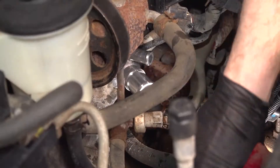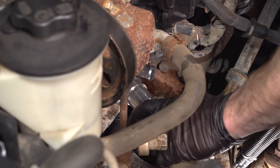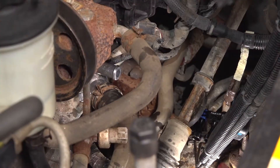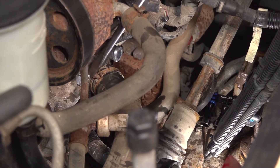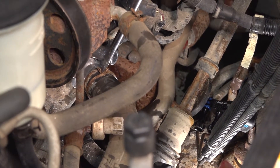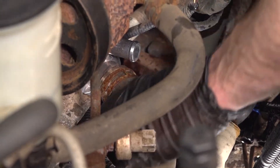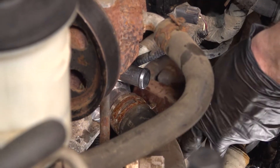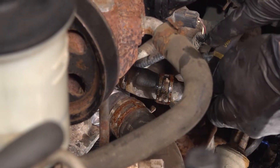Double check to make sure it's completely secure. Let's continue on to the lower radiator hose. We'll take this and slide it into place on the thermostat housing, press it in as far as possible, and reinstall the clamp. A little bit of a tight fit — that's what you want. With these clamps, if they're stuck, you want to make sure they retract up against that hose. Use a pry bar or screwdriver to gently try to separate that area. Careful for any pinch points. Make sure we get this clamp situated, give that hose a nice tug, and double check it's completely secure. Do the exact same thing to your other hose — slide that on as far as possible and get the clamp in position.